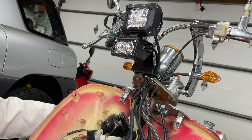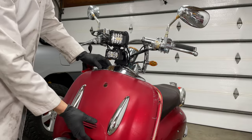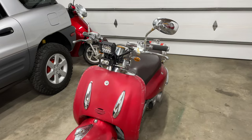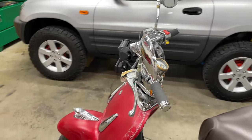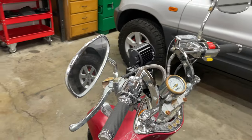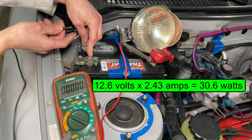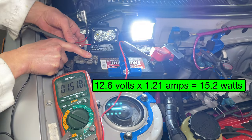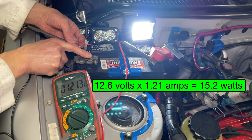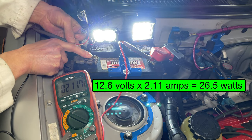Let's test the lights. Key on, and the low beam is on. Hit the dimmer switch, and the high beam turns on too. It looks like they work, so I can put my scooter back together. The new off-road lights look... different — they definitely don't match the style of this scooter. I'm checking the power of the old incandescent light — it's about 31 watts. I want to make sure the new lights don't use more power than that. The LED low beam light is taking 15 watts, and with both of them on we have 26.5 watts. Great — that's less power than before.